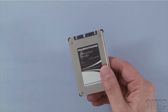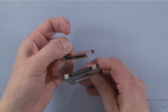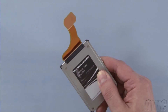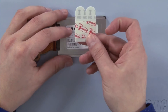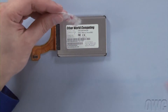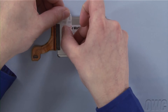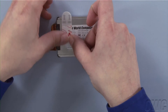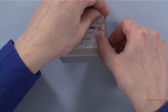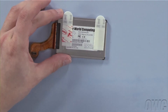With the Mercury Aura Pro MBA, there's also a ribbon cable. You'll notice that the connector on one side of the ribbon cable matches up with the connector on the SSD — attach these two pieces together. Also in the package will be two adhesive pads. Peel off the backing on one side and attach them to the Aura Pro so that the tips barely stick out over the edge. Once they're attached, you may remove the backing from the other side and proceed with the installation.